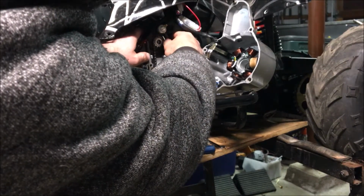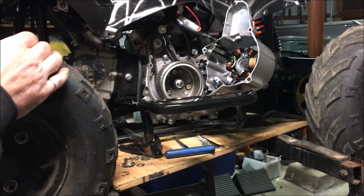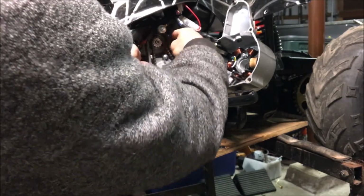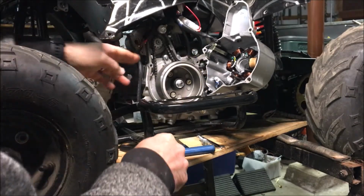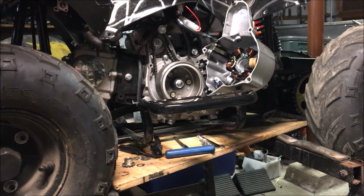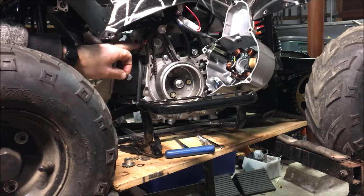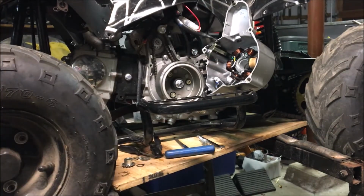Okay, here you have it. Just have the motor in there, not tightened up too much, and just push the sprocket in, and then just slide the starter motor forward a little bit more, slide the sprocket back in, and there you go. It's installed, and just gotta tighten up that motor. And where's my little clip? I'm gonna use the same clip. The clip from this motor is this one. It was on the bench. And we'll put that clip in, and we'll attach the power, and we'll clean up this gasket a little bit and put the goop on.